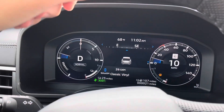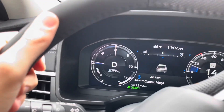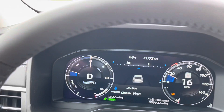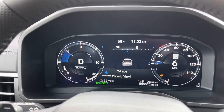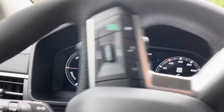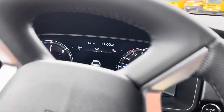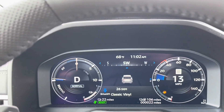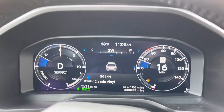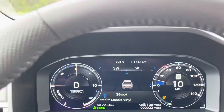This will be good on roads where there's a lot of stop and go, a lot of slowing down and speeding up — your nice curvy back roads where you're doing 30 on the straights and 20 around corners, or through the city when you're constantly doing 20 miles an hour and then stopping. Now as I let off the gas pedal, it slows right down to green. It feels like we're in B5 — the car just feels like it's braking. We speed up, then let off, and it dies back down. This will be great in a city environment, anywhere with a lot of slowing and speeding, because normally you'd just be wasting all your juice hitting your brakes and gas repeatedly. As I let off, it goes down to green, meaning we're putting some juice back into the battery. There's your One Touch pedal system.